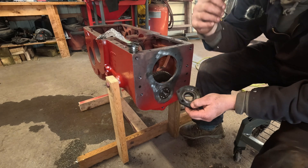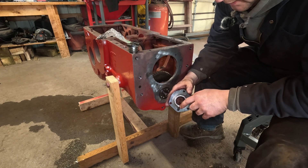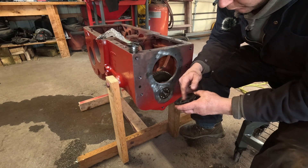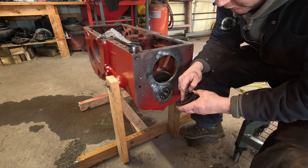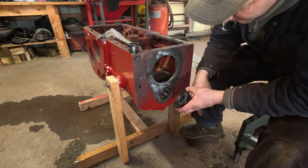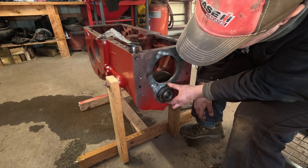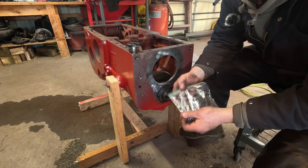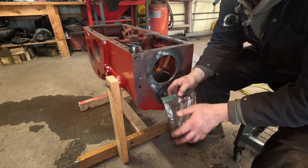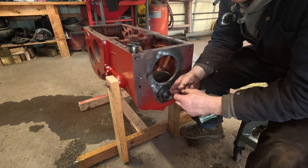One thing to note — like with the input shaft housing assembly that goes right here — there's a drain hole that has to correspond with the hole on the casting, so that any oil that passes through the bearing and lubricates the seal, any excess oil can drain down through, go through this cutout in this housing, and go back through this hole here. We've got to make sure that gets put back oriented in the correct location. One thing I do is I put all my bolts or any small parts in baggies and label them, so that way two, three, seven, eight months later I go back and I know exactly what bolts are for what — no guessing games.